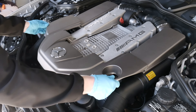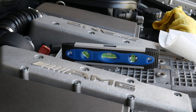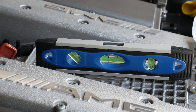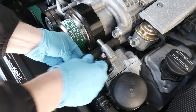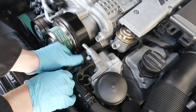To start the job you want to pull off the front engine cover. You then want to place that level on top of the supercharger and jack up the rear of the car until the unit is level, or you can park on an inclined driveway. Next you remove the two hoses which are part of the secondary air injection system — that allows for better access. They just slide out; you can pull them out by hand.